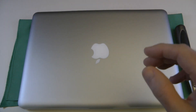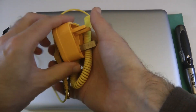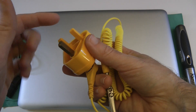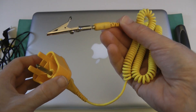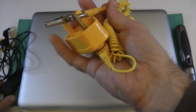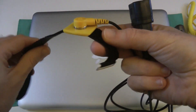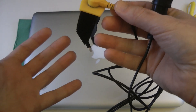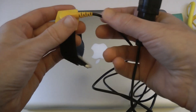I'm also going to be using an anti-static wrist strap. This comes in two parts. This part here plugs in underneath my desk — it's just got an earthing pin, so it doesn't use the live or neutral, it just uses the earthing pin on my house circuitry. There's a crocodile clip on this end, and then this crocodile clip attaches inside here, and it goes all the way round and attaches to a Velcro wrist strap. This makes sure that any static electricity built up in your hands is got rid of and doesn't damage any of the components in your laptop.